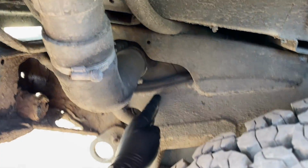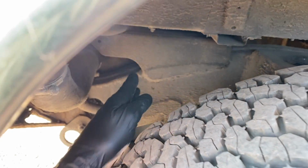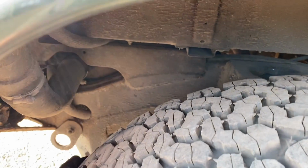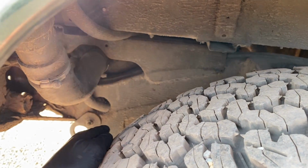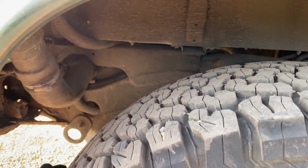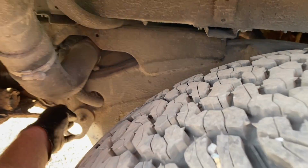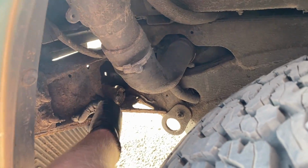I mean, we could actually just cut and weld here, it's strong here, but I always try and carry it as much further back as possible. And we have a rear quarter anyway, so we can take it back and do the rear quarter. And yes, pretty much we're just going to get the rip saw, cut the chassis, and cut the loom as well, stuff the loom back inside, and get this job done because this cross member has absolutely had it.